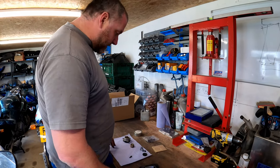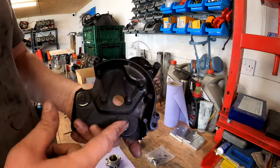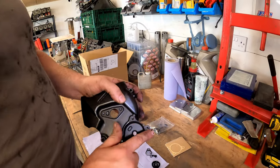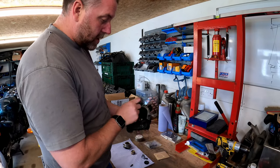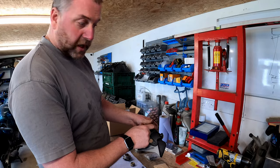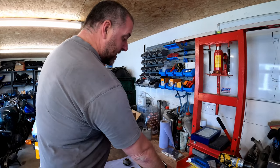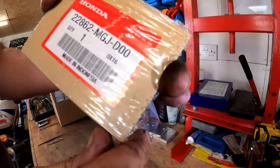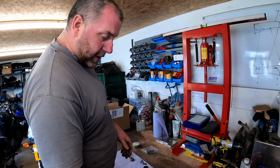I've had a bit of a cleaning spree and everything's now nice. What I also did was I took the sprocket cover off. It's not perfect but it's a lot better than it was - this was absolutely thick with chain lube so I've given it a bit of a clean out, and it was also a lot easier to get the old gasket off with it off the bike. Here is the new gasket - this is a genuine Honda one. There is the part number should you need it - I'll leave a link in the description to these parts.